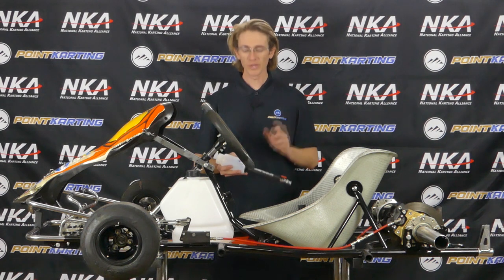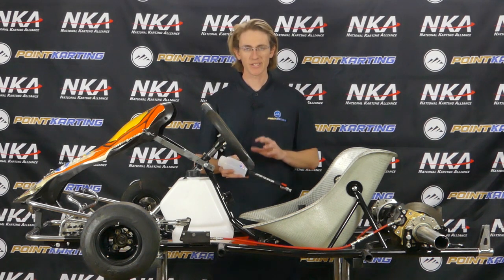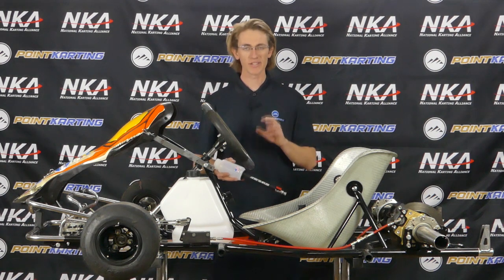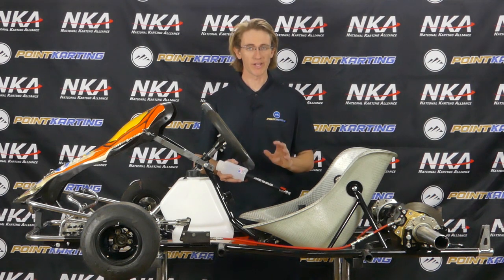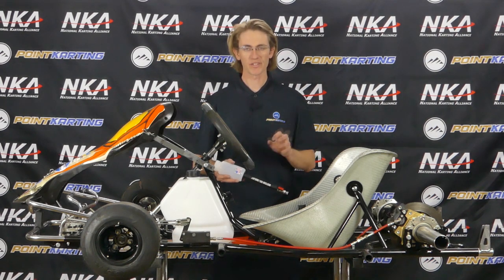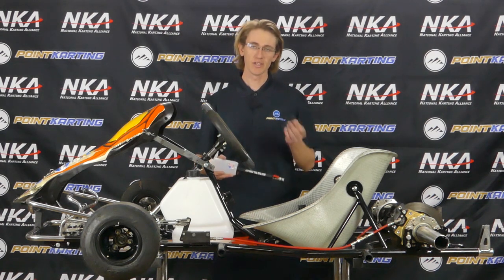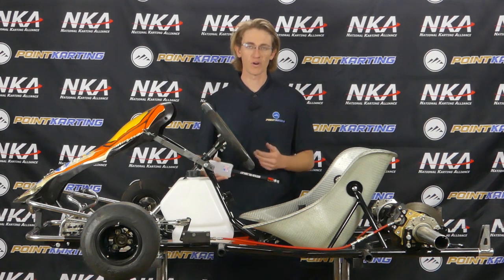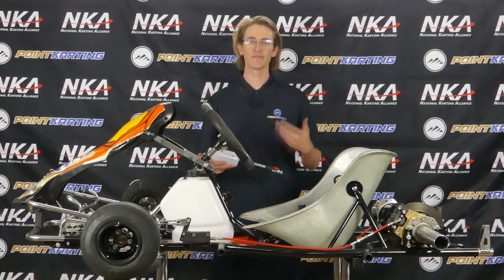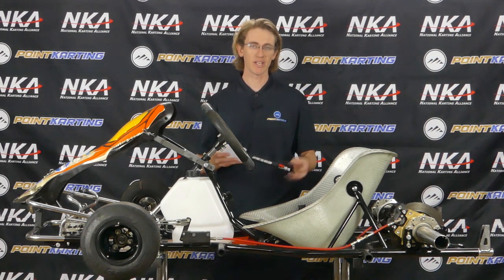For this video, we're going to take a look at how to use a remote brake bleeder system like this TDC brake bleeder, but it's not required to bleed your brakes. However, on systems like this one here on this DR Torque, it is going to make the process much easier, because there is not a lot of fluid in the system, so it's easy to introduce new air into the reservoir if you have to keep refilling it. That's where a remote brake bleeder like this comes in handy.